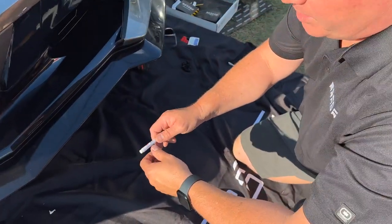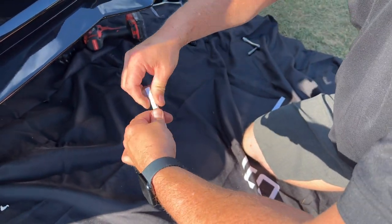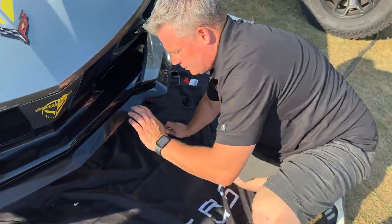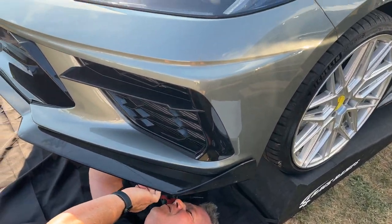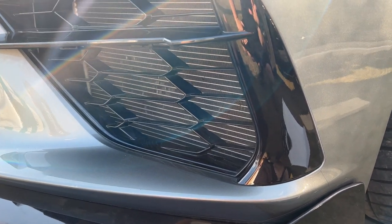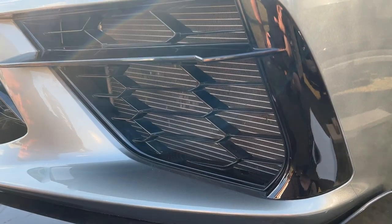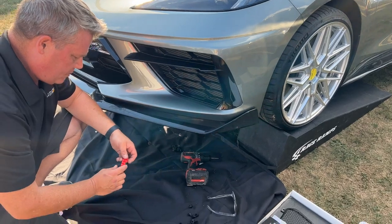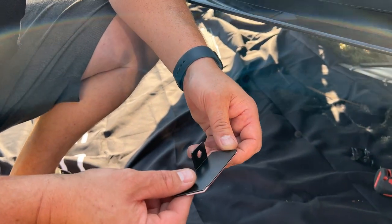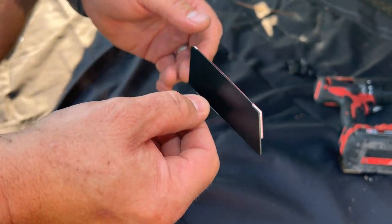Next, we put some adhesion promoter on the two pads where we're going to place the two lower brackets — those areas we just prepped with the alcohol pads, the same area where we pulled that sticker off. Everything is included in the box. The kind of tape they use along with the adhesion promoter ends up being the same strength as a rivet. These lower brackets are keyed into the molded sections of the parts — this small key will drop into a notch where it can't be misaligned.